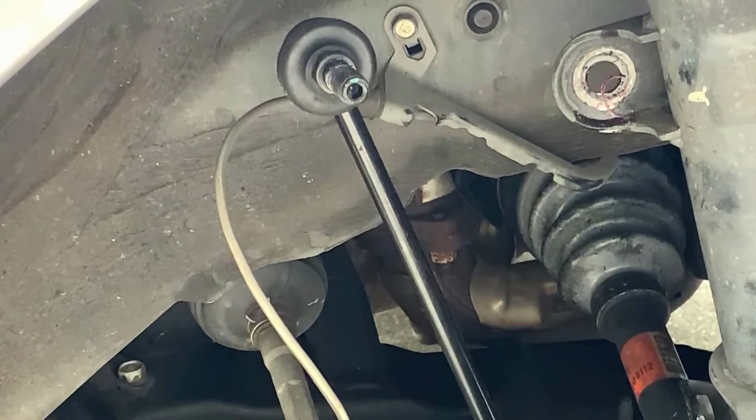The first is you can separate the axle inside the boot. That's actually pretty easy to recover from. So in that case, you would just manipulate and move the lugs back and forth on the outside of the wheel, and you'd be able to pop it back in. It's not fun, but it actually will go back in. I don't want to ruin the surprise, so we're going to save the other problem for later.